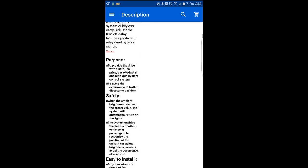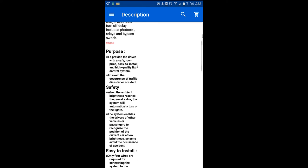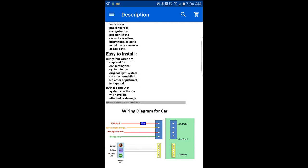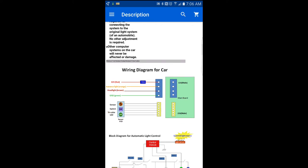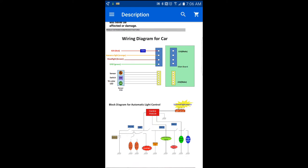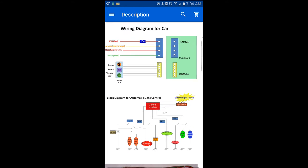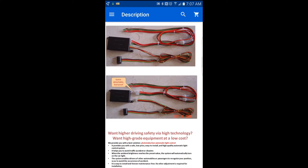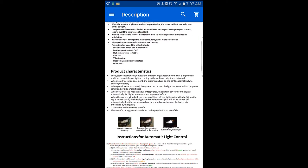You can get this on eBay — I'll put the link in the video. It's from Taiwan and they're very responsive. I've already sent them a couple of questions. It has a lot of detail in the listing. It also mentions that it can be wired up so that when you turn your windshield wipers on, it'll automatically turn the lights on. Don't let the wiring part scare you — the main thing is those four wires: the red, the orange, the brown, and the green. The green goes to ground, so really you're just talking about three wires.